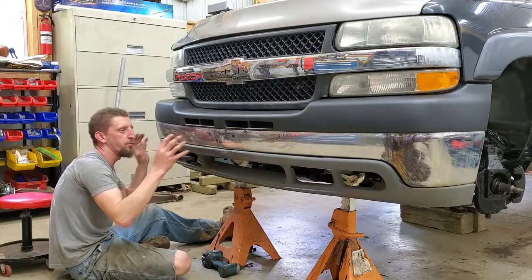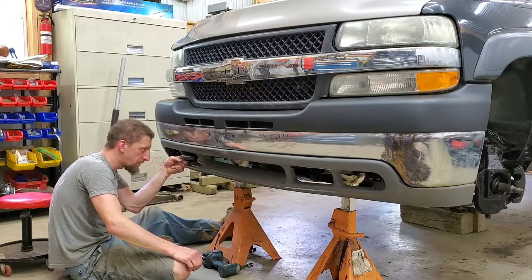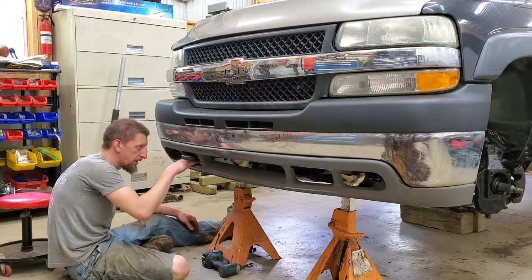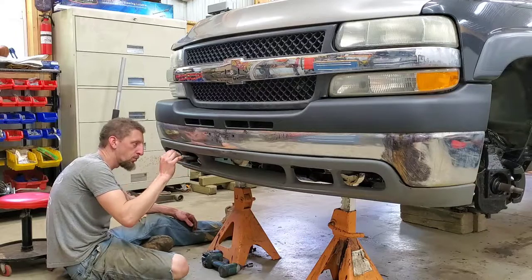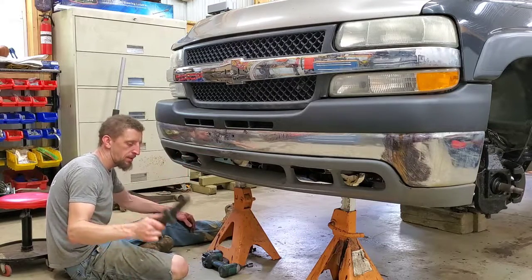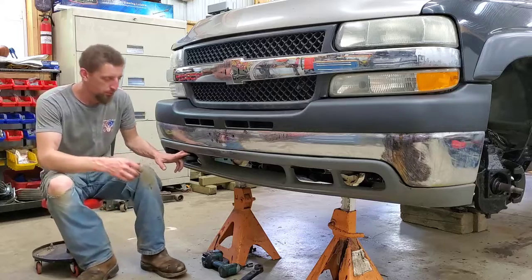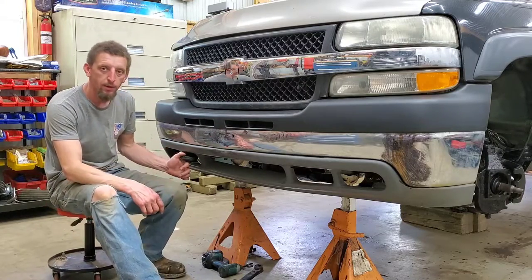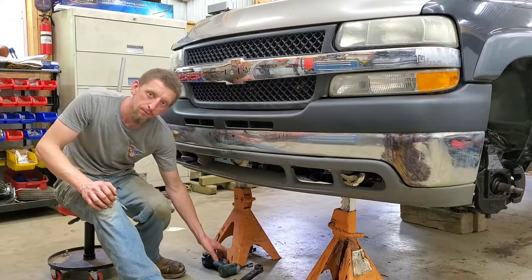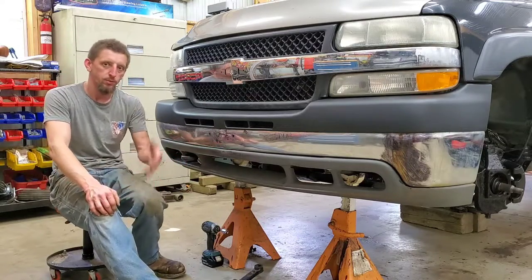Then what I'm going to have to do is, once I remove the bumper off the front of the truck, come in here and drill two new holes right below the old factory ones. Then I can use the tow hooks within the frame rail and not have to get crazy doing any kind of modification with steel down below, or make a new mount, or completely drop the hook down to a location that wouldn't be very useful. So I still have to modify this one, but I am going to do that later on. I at least wanted to touch on how I'm going to finish the tow hook mount, letting you know that there's a pretty simple option. Depending on what platform you are working on will probably determine how you finish the install with the tow hooks, and that's ultimately up to you anyway.